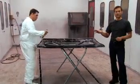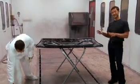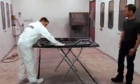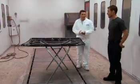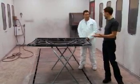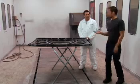So just as Dave is showing you here, wipe it off as you go with a clean, dry rag. All right, so now your hood is thoroughly clean and it's time to blow and tack. Well, next up, we apply the base coat and clear coat according to the paint manufacturer's specifications. So Dave, what was our total prep time? Total prep time, Chris, was right about 16 minutes.